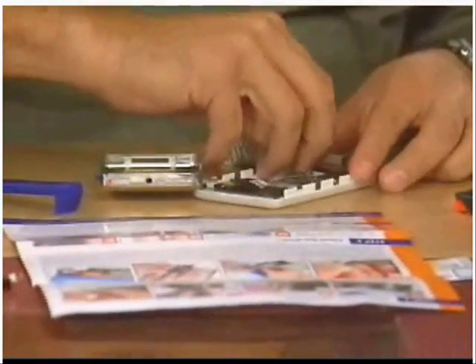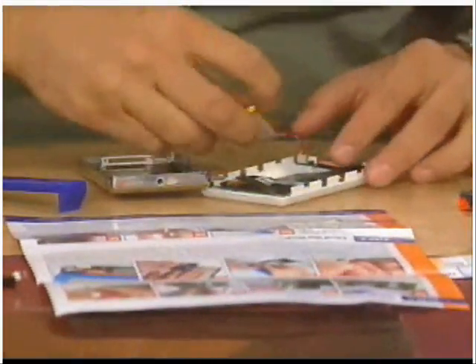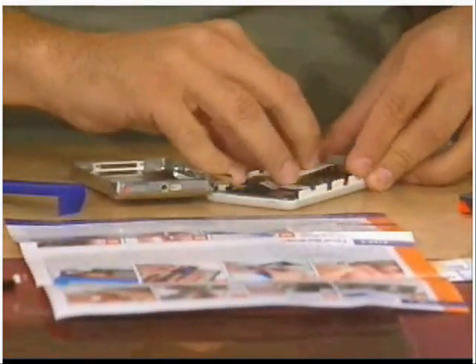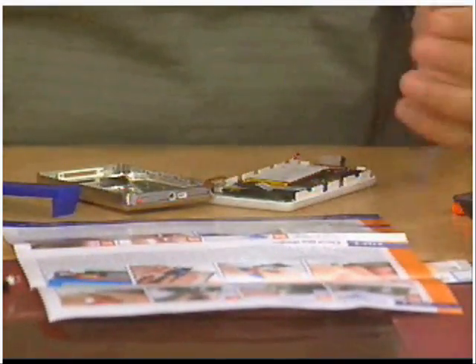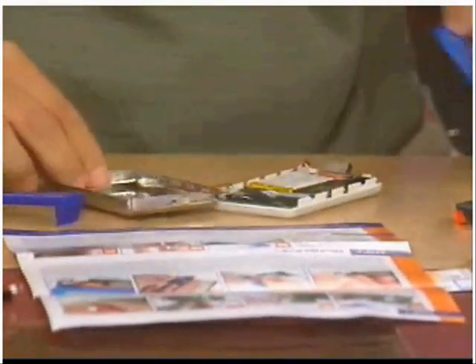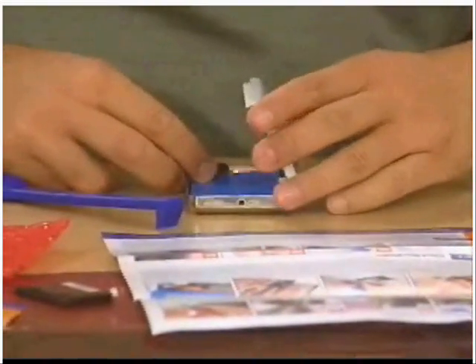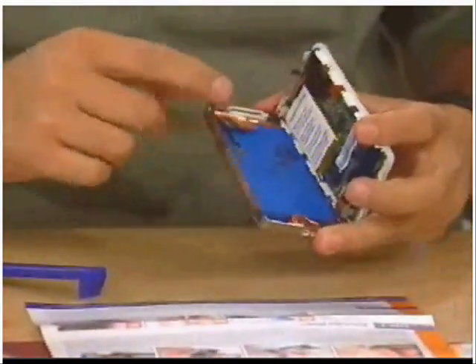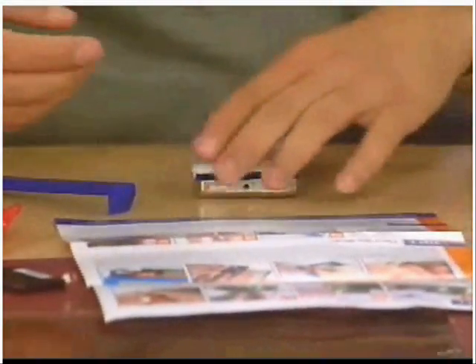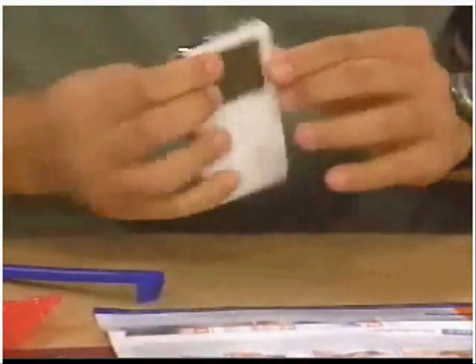I guess I should get this back in there correctly. Got that in there. Tuck those wires back in. I'm following the directions here — it's really simple the way it tells you how to do this. It's just been a few minutes already and we're knocking this out. Okay, that's in there. Let's put the hard drive back in there. If you notice, there's the hard drive ribbon cable — just connects right there. It tells you how to do that. So we're just going to snap this back on there, seal it back in, and let's see how our battery works. If it works.